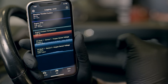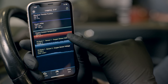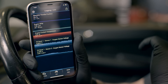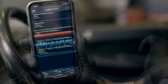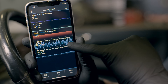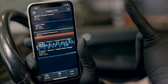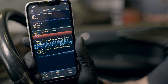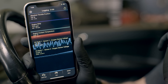Here we're seeing bad data from sensor 1, the pre-cat sensor. Before, the sensor would jump between low and high values, but here we can see it's just staying in the middle showing only smaller values. Here's another example of bad data from the pre-cat sensor where the data goes wildly from 0 to 1 or stays in the middle and is not consistent in any way. If you have either of these cases, you likely need to replace that sensor.